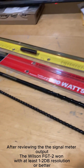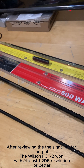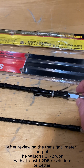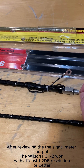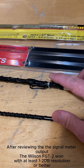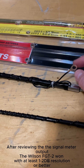The K40 is not the strongest materials — some people have said they break easy. I don't know if that's true, but it is a little more flexible than the Wilson. The Wilson is a much beefier antenna. It also gives you an option if you don't have a place to ground your 3/8ths mount — if it's not magnetically coupled, you can use this little strap here.